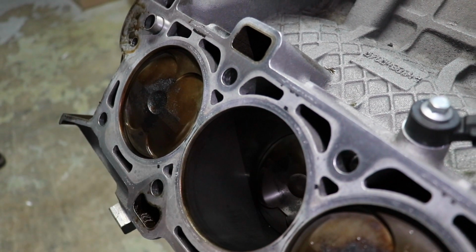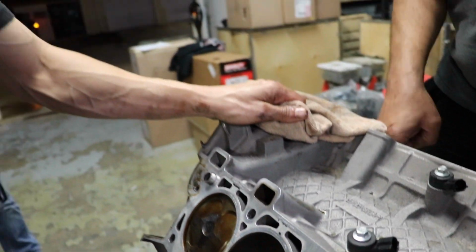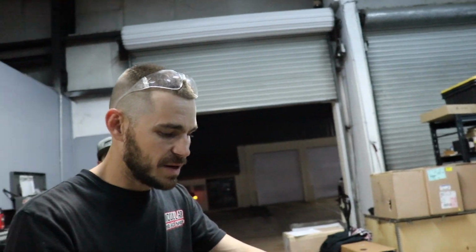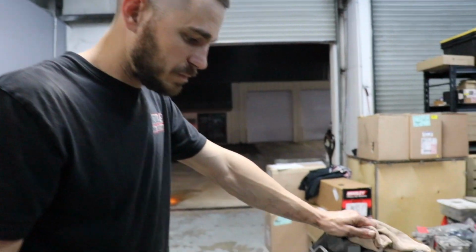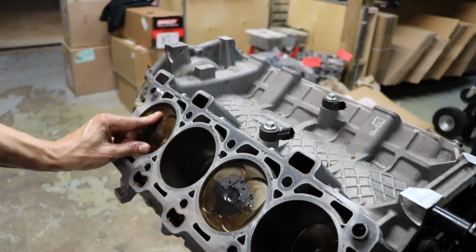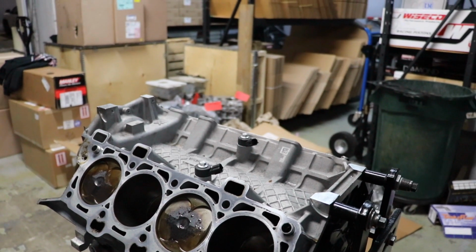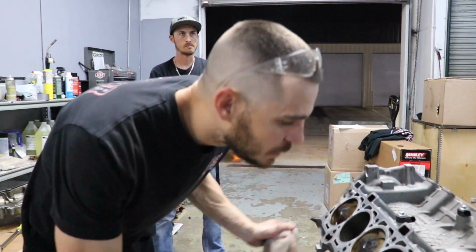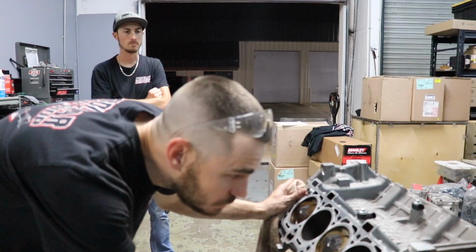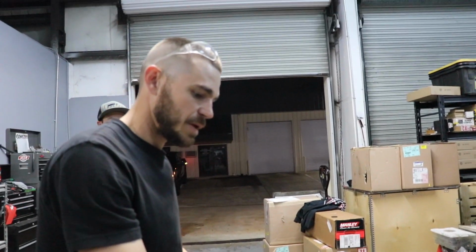Not normal. I mean, it's what you typically see when you're tearing down an engine making that kind of power, but I'm thinking the rings may have butted just a little bit. Yeah. See any reason why the water would have been all inside the pan? Cylinder in the pan, because when we drained the oil, nothing but water came out for at least 15 seconds. Straight coolant, actually.